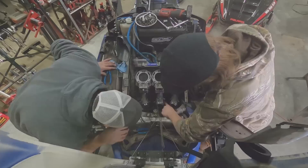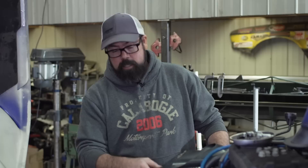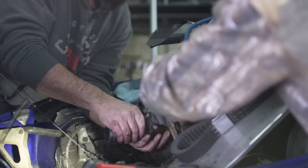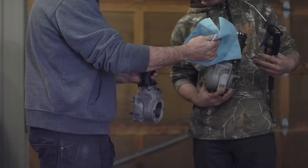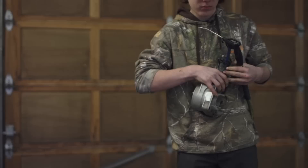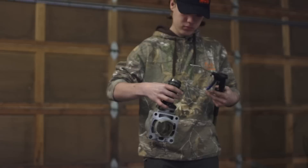At this point we've got some good news and some bad news. The good news is these are standard bore 69mm pistons, which means the standard bore replacement rings I've got are going to work here. The bad news is one of the exhaust valve cables was broken, which definitely would have killed some of the top end on the SRX, but it also means I've got to find one before it's going to be running again. Next part in this rebuild is to clean everything up, replace the rings on these old pistons, and then start reassembling. This broken cable will push back the finish of this job while we're waiting for a new cable to arrive.